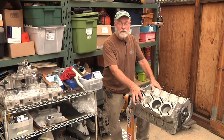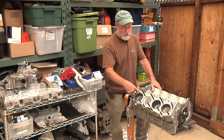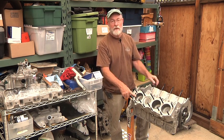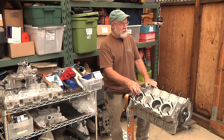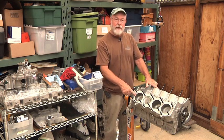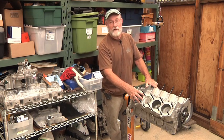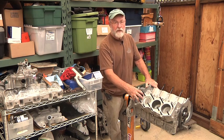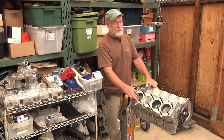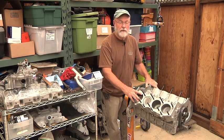One of the things to look out for with a 3.5 liter Rover V8 is that with these pressed-in steel cylinder liners — which for the most part worked just fine in this aluminum block engine — if the engine ever overheats, there can be an issue where that cylinder liner gets coolant behind it. The liner and aluminum expand and contract at different rates, and that coolant acts as a lubricant, allowing the pistons to push the liner up and down inside the block while the engine is running.